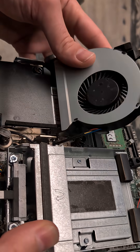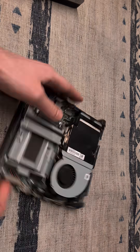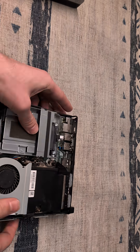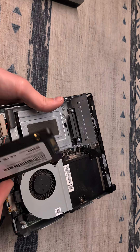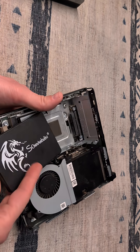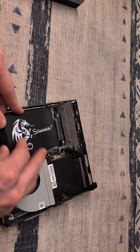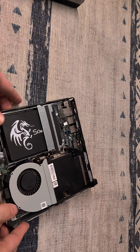Then we can put our fan cover back into place. We have to line up the notches just right so that it hinges up and down. Now that that is into place, we're going to put our SSD bay in. We'll flip this up right here. Officially we could add the screws to the side and mount it in properly, but this really isn't going to be moving once it gets put into place. So we're going to line up our notches and just slide this drive in, and then put this pin down.